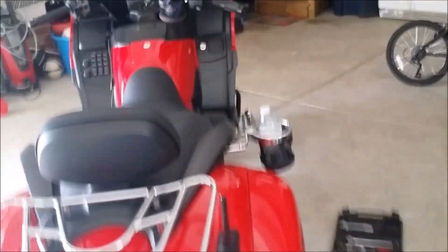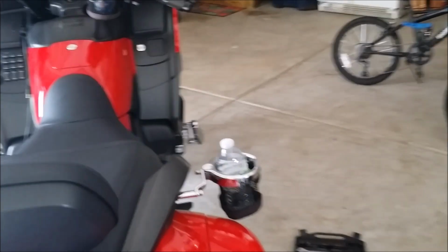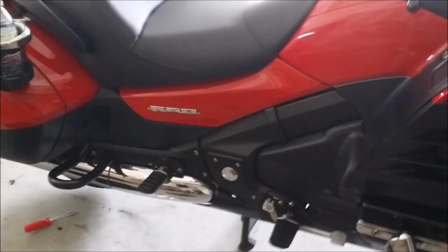All right, I'm going to take this out for a ride now and make sure that I don't get that clunk. I thought I just had to ride it out for a second because my caliper was getting readjusted to the rotor, but I had the pad on wrong, guys. So be careful out there, man.